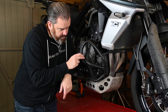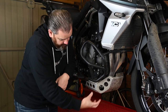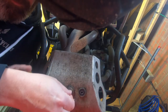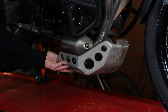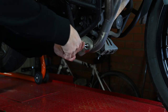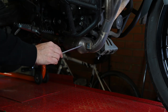I've got the bike up on the stand to make things easier. Having had a look, I reckon I can actually get the header out without taking the crash bars off — it looks like there'll be enough room to maneuver. To be able to maneuver the exhaust out this definitely needs to come off. I'm using a 12mm socket to undo the four bolts underneath, and next is the shield for the cat — getting that out of the way will make things easier.